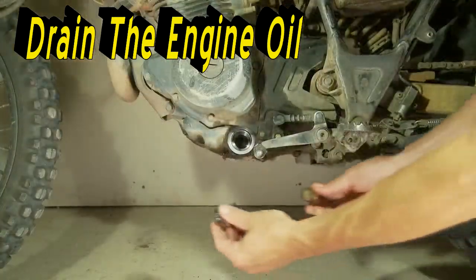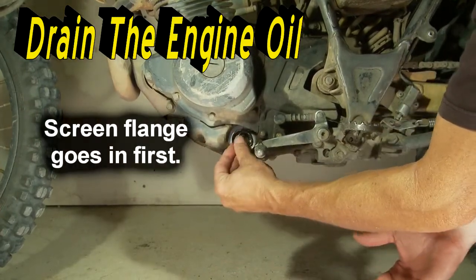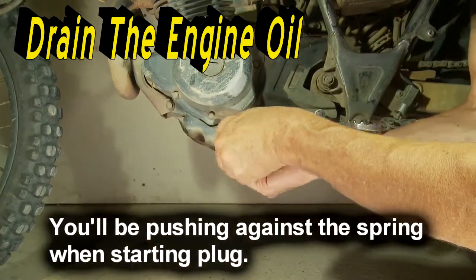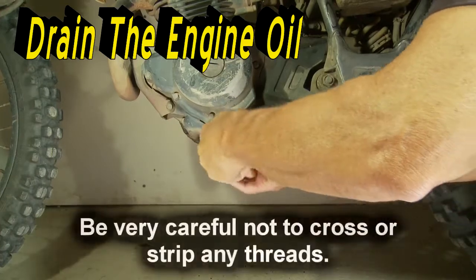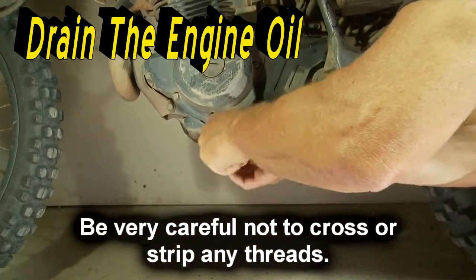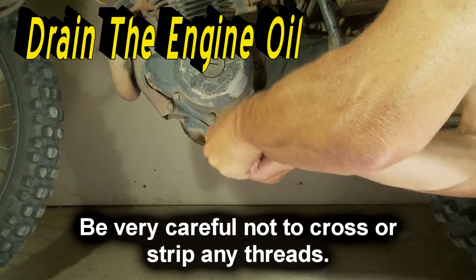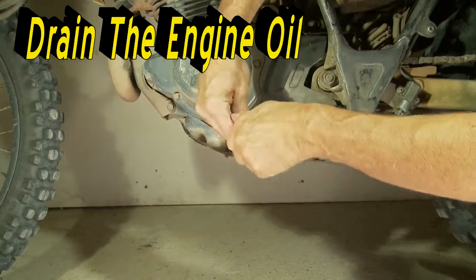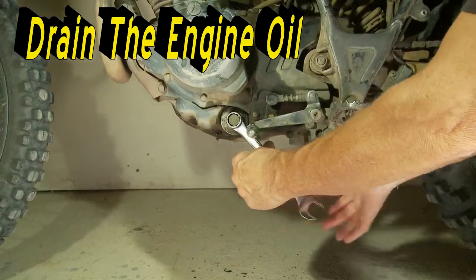Position spring over thimble screen as shown and insert into the drain hole. Proper orientation of these parts is very important. Using a socket with extension will make starting the drain plug easier. The engine and drain plug threads are soft, fine, and delicate. Make sure not to cross-thread the plug by forcing the start. The plug should screw in easily by hand. Make up the threads by hand until the O-ring seats. Tighten the plug using a box wrench to the same approximate tension used to loosen it.